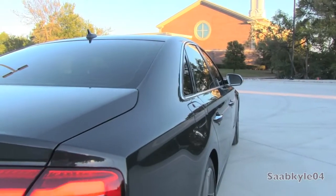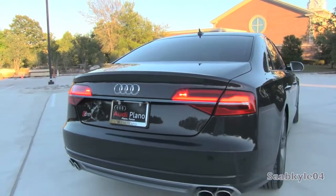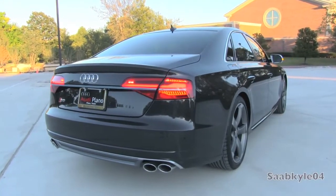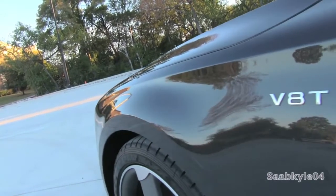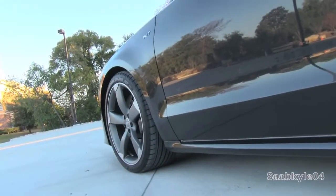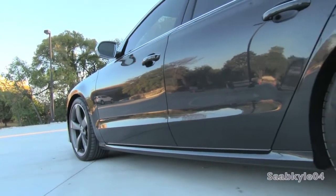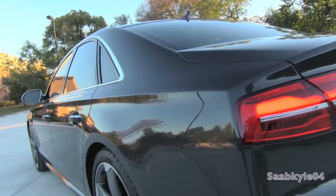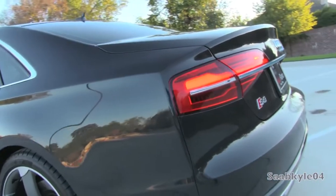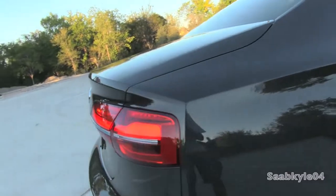One of the S8's biggest advantages in its class is its comparatively low curb weight, beginning around 4,400 pounds thanks to Audi's aluminum space frame construction. The body itself weighs just 509 pounds, with every panel being formed from aluminum aside from the ultra-high-strength B-pillars. This saves an impressive 220 pounds or so from a conventional steel body. The chassis also utilizes a high degree of aluminum, from the aluminum castings that support the high-stress areas to extruded aluminum sections and sheet aluminum that make up the rest of the main structure and components.